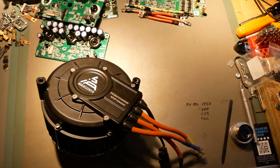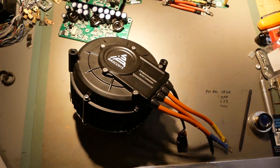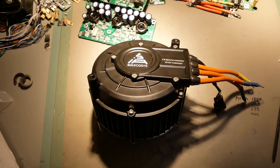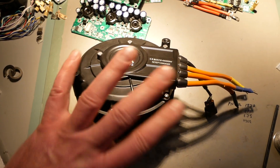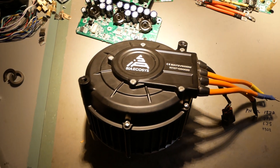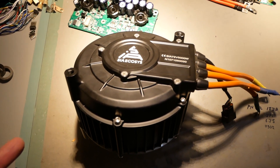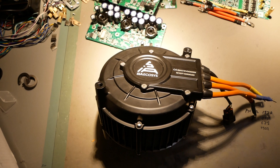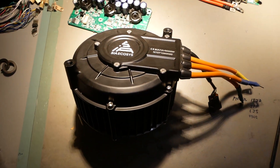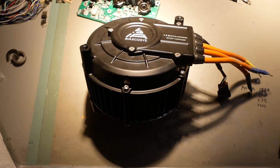You're going to see this thing taken apart. I am going to measure the resistance and the inductance on all three phases. I've got a gauss meter so I can measure the magnetic strength. We're going to look at how the magnets are laid out and the windings. I will also run this on a controller so we can see the thing in operation, and then we can see, unloaded, how much losses are in the motor — because that's what your amp draw on your controller is going to be. It's basically whatever it takes to run the motor. We're going to get a table of motors and how efficient or not efficient they are.